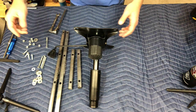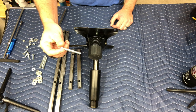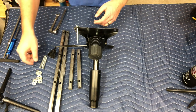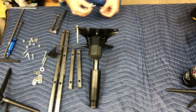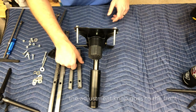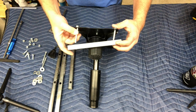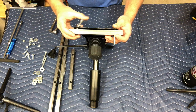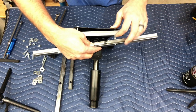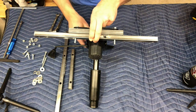To make this easy to see: I've got the vertical adjustment cylinder here and the seat base. I need four two-and-a-half-inch bolts that are five-sixteenths in diameter. I always use washers on all my hardware. We slide these through — back first — then slide the cylinder in, and take the bigger piece. For your finished product you'll want to paint it to make sure it looks nice.